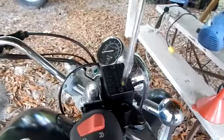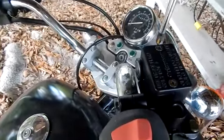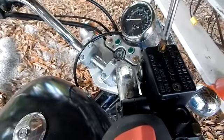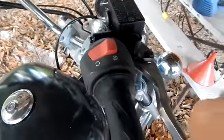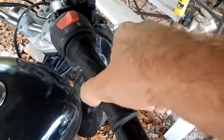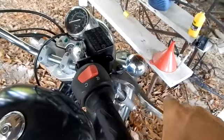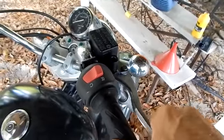Got it together, drove it around a few miles. Brake was working fine, released every time. But about 48 hours later that brake was dragging again, so this didn't fix it. I guess next time I'm going to be tearing the caliper apart and looking for any corrosion or problems with that.